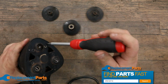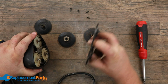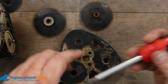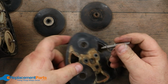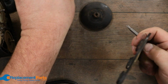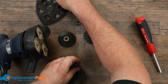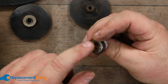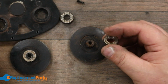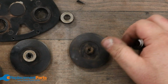We'll just have a quick look inside here. And there comes your plate right off, and there's your bearings still sitting inside. We can just press them out. It doesn't take much force. I can literally just push. There's the one bearing. They're just pressed into this plastic. It's fairly simple. Again, these bearings you can go back to the manufacturer for, or they're just off-the-shelf type of bearings. What we need to do, though, for the manufacturer is go back and get these particular plates.